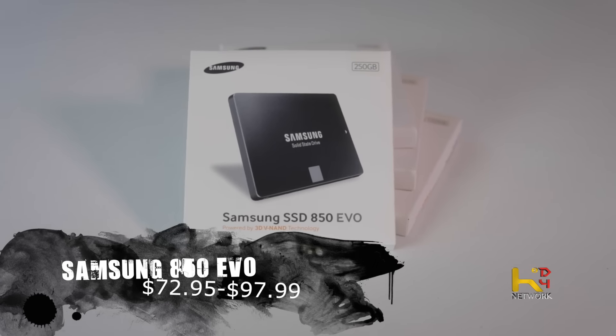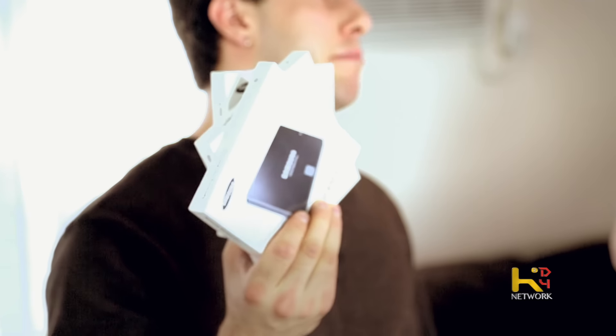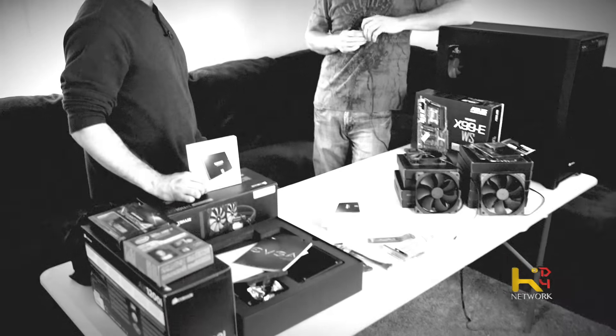For the rest of storage, I have three 120GB Samsung SSDs that I'm going to RAID 0 so they appear as one large drive for the rest of my games. The downside is that if you lose one drive, all the data is lost — but they're games, so I'm not too concerned. I'm more focused on loading times and making things as fast as possible. The trade-off with SSDs is that when they fail, they fail suddenly with no warning, unlike spinning drives.